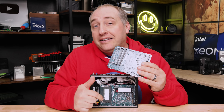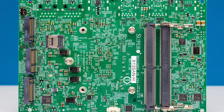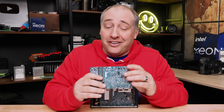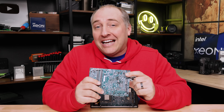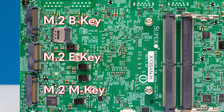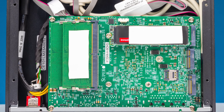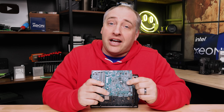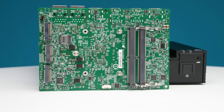On the bottom of the motherboard, we have DDR5 slots - dual channel memory, which is awesome. A lot of the lower-end all-E-core systems only have single channel memory, but this particular motherboard has a Core i7. The memory is far from the only expansion area - we have at least three M.2 slots that are all different. The top slot is an M.2 M-key, the middle slot is an E-key, and the bottom slot is a B-key. The M-key slot is for SSDs and is a PCIe Gen 4 x4 slot. The E-key is PCIe Gen 3 x1 with USB and CNVi for wireless LAN and Bluetooth cards.